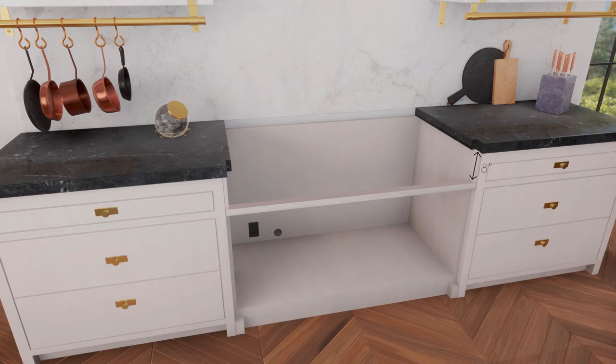To cut the countertop opening, allow eight inches of free space below the surface of the countertop, and allow additional clearances below the burner box to install the regulator and make house supply connections. Use a 90-degree elbow to route the gas connections and limit interference with drawers or other cabinet features. These range tops are designed to hang from the countertop by their side flanges. Smooth any rough edges on the countertop before installing the range top. Formica countertop edges must be finished, and the countertop must be strong enough to support the weight of the range top.